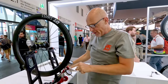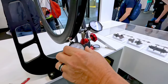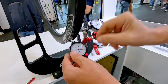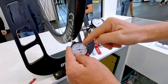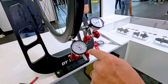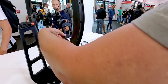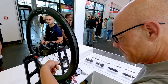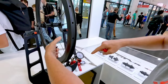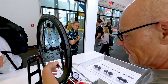Now we have the third step: that is the height kick. I will put the indicator on zero here, and now I have to bring it into a tolerance of 0.4mm. So now here I am out of tolerance, and I am going to strengthen this spoke here. But now the problem is, when I make it better here, I am losing my side kick again, and I have to strengthen also the left side because I may not lose my side kick.